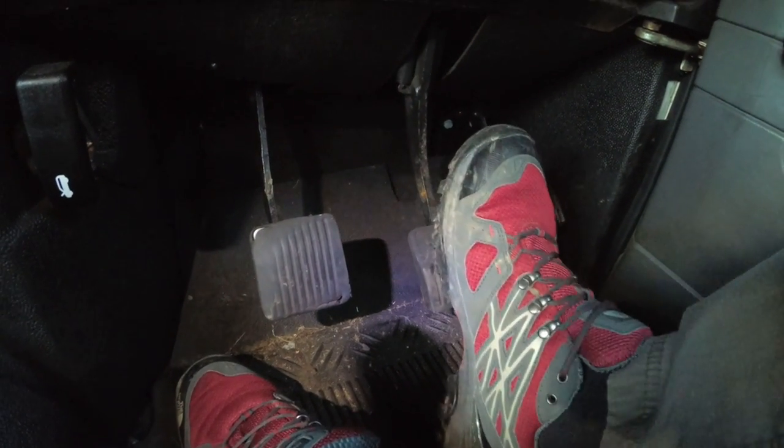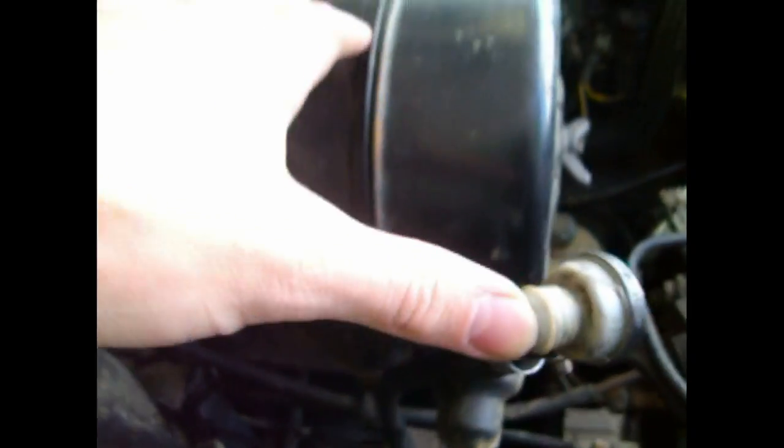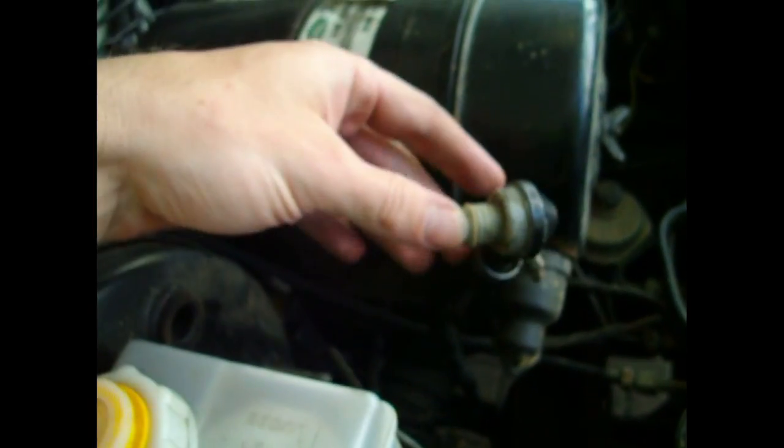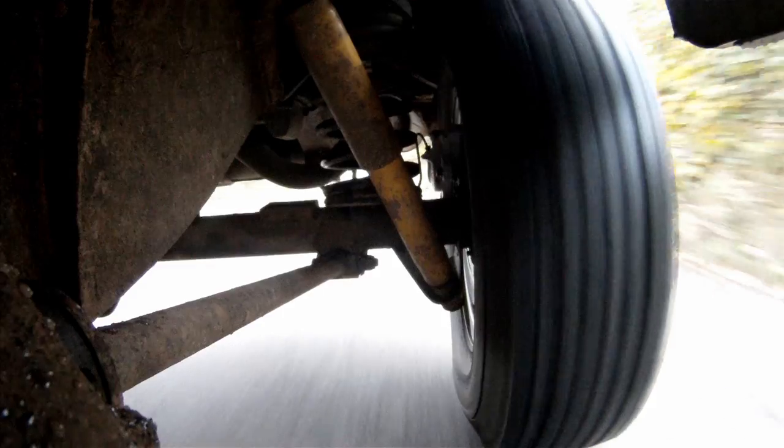If it was the other way around and let's say you had a good brake pedal — if you braked soon after braking previously it would feel worse — that would probably mean you were using up vacuum and the vacuum wasn't being replenished quick enough to get a good pedal on the second time. Whereas this was the opposite: relatively soft to begin with, then it would get harder afterwards, but the further I would drive without touching the brake pedals it would then be soft again.